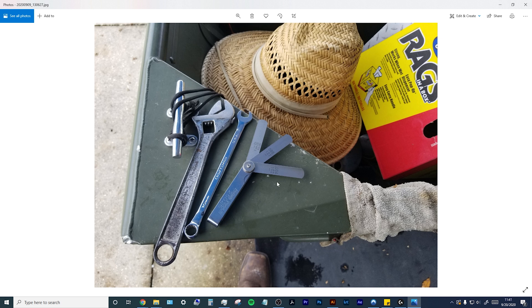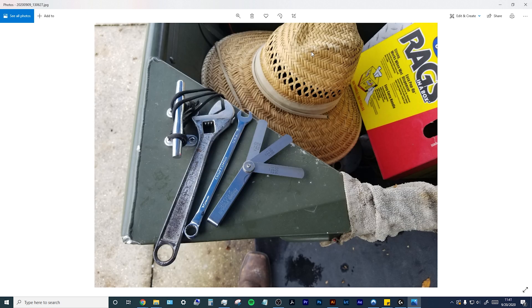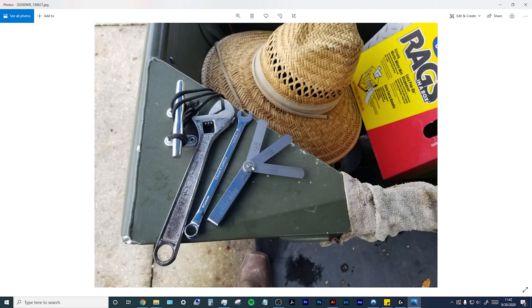This is a picture of the tools that I used. The top of that nut is very, very small and I didn't have a wrench that fit it, so that's where I used the adjustable wrench. The 10 millimeter — I believe — is this lock nut. So you'll need that and then your feeler gauge. I can't stress it too many times: 0.004 should fit, 0.005 should fit tight, 0.006 should not fit at all.